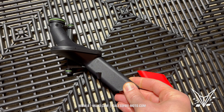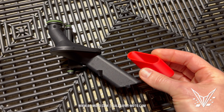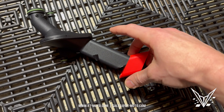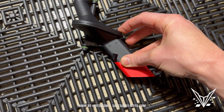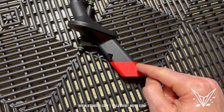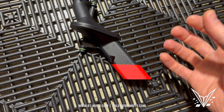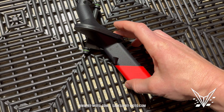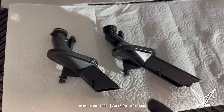Now it's time for a very important part: trimming the pickup tube for the oil pan. Because we are installing a shorter oil pan, the pickup tube needs to be shorter itself. For that, we provide you with a template in the kit — this should come with your oil pan. Slide it on the bottom of the pickup tube and you can see it fits right through the bottom. Trace a line exactly with this template and cut exactly on that line. If you cut too high, it's going to be sucking air into the engine instead of oil. If you cut too low, the new oil pan will not fit on the bike. It's very important you get this part exact, but if you follow the template you won't have any issues.